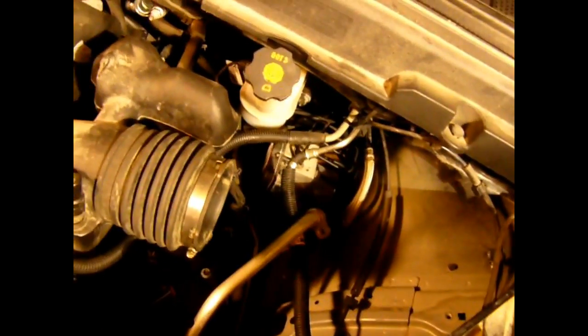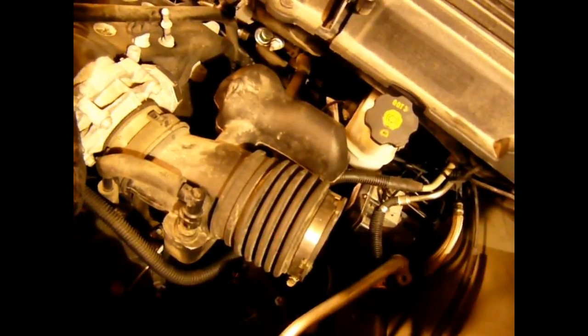I'm not taking the engine out. I don't need to disassemble that. The last one I did, I unhooked everything off the engine, and it was a pain. Obviously the airbox is gone. We got refrigerant lines for the AC. The harness down here that hooks into your ABS module. Couple grounds. Anything that's attached to the engine and the firewall or the core support has to come off. And I think I'm about ready to start dropping this out of the car. We'll see if I forgot anything.